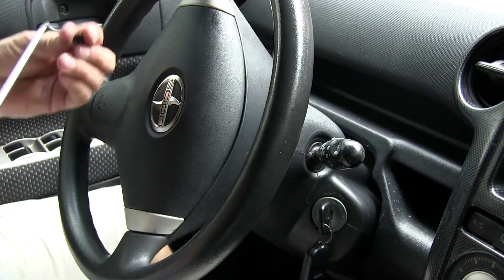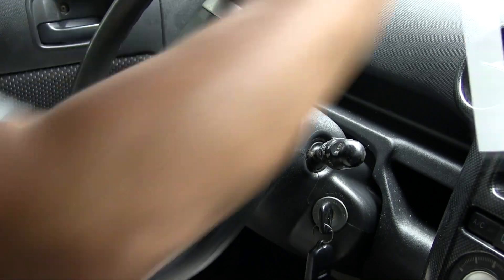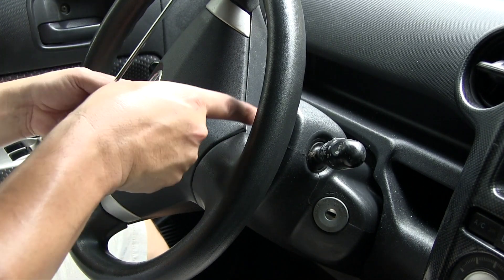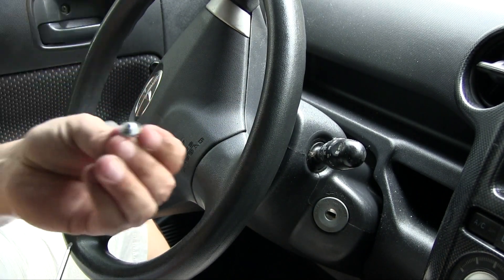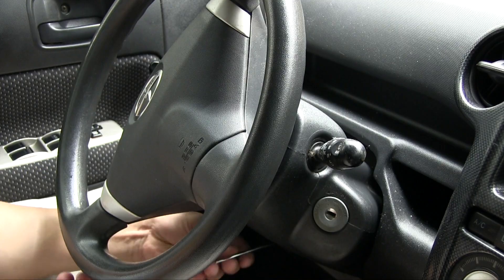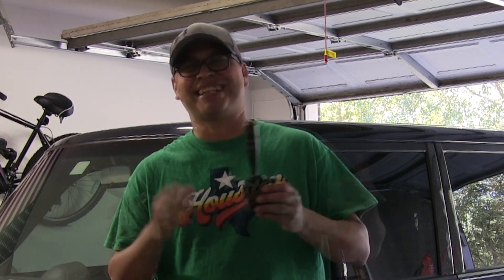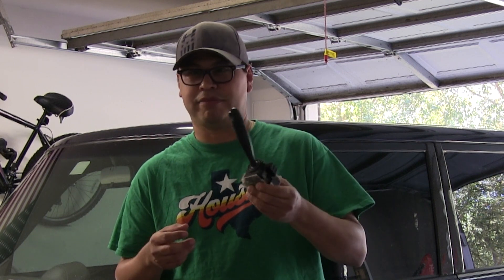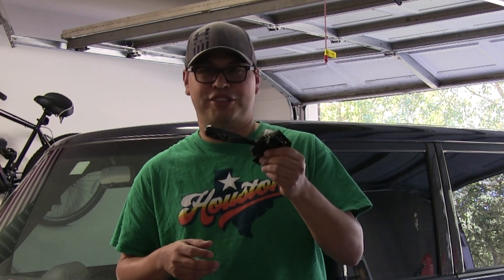Always make sure that once you put these two screws in on the sides, don't forget the small screw down at the bottom. Well, there you have it - we just installed the wiper stalk on the Scion xB. It's not that hard. Grab a couple of tools; you can find these wiper stalks in a Pontiac Vibe and some other cars. It's just easy plug and play - a very easy mod, so I do recommend doing it. Like, subscribe, comment - we'll see you on the flip side, peace.